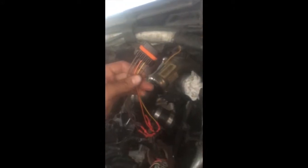About to put on a new pigtail - you can tell this connector is super burned, all messed up, and there's literally no wire to work with. Cutting these wires and splicing the new pigtail wires into the old. Got my new valve cover connector with shrink heat tube done and ready to plug in. Then I'll put the intake back on, get the turbo connected up, and see if she fires up.